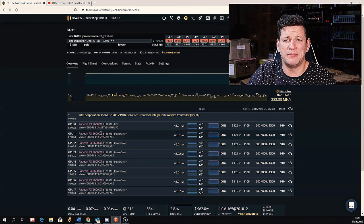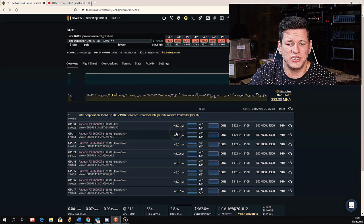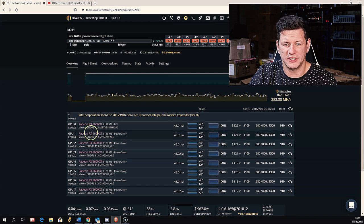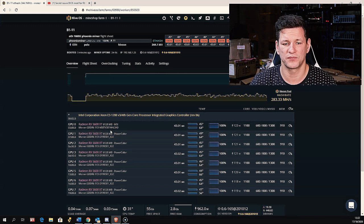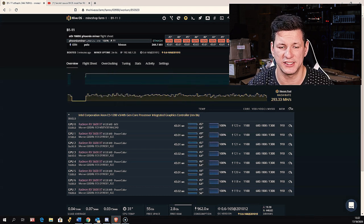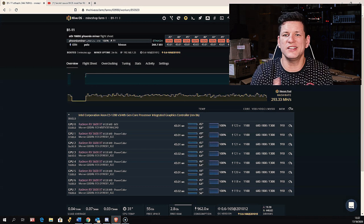The funny thing is you can also upload a different brand GPU's BIOS onto a different card and it will work just fine. I have a couple of different BIOS for the RX 5600 — one is from Red Panda Mining's MSI RX 5600 BIOS, and the other is from a Russian YouTube channel. I've uploaded the PowerColor BIOS onto Sapphire Pulse cards and they've been hashing perfectly for about 24 hours. Both BIOS files will be linked in the video description.